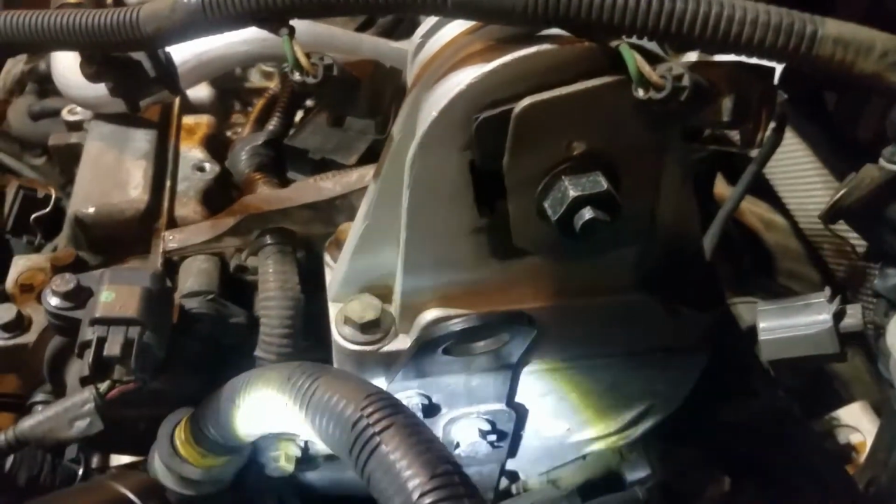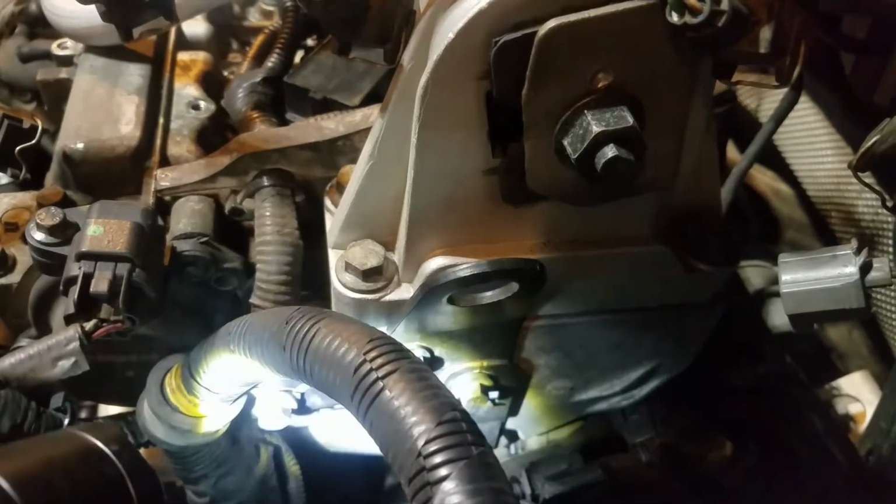is up under. See that little bolt sticking out right there behind that vertical support piece? This right here goes down to the banjo bolt. So I've got to take this off, and I think this is nothing more than the lift point for putting in the motor. There are 3 10mm bolts. I'm going to take those out and see what I've got.